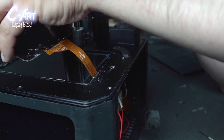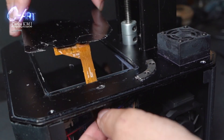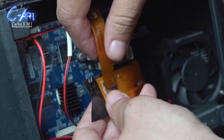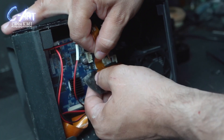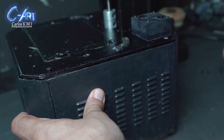When you have your new screen, it's easy — just slide it in. There's no specific orientation, just slide it in and you'll be able to see it. Attach the connector again: that tiny square with the pins will make a tiny click so you know it's attached. Then put the tape back, close the panel, and you should be able to just print. You may need to do a firmware update.